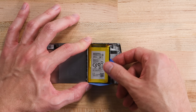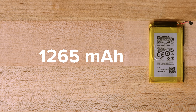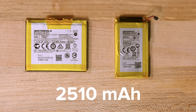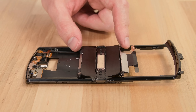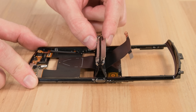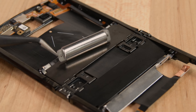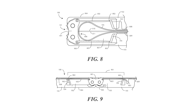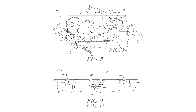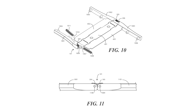That secondary battery is glued and placed in a well on the underside of the display. The idea of prying a battery out against a delicate OLED display is not our idea of fun. This battery is rated at 1,265 mAh, bringing the total battery capacity of the Razr to 2,510 mAh, which is fairly low compared to other flagship phones. With the display out of the way, we can see how the hinge works — it comprises a continuous geared hinge, a cat head cam, two support plates, and a few springs. Motorola's patents illustrate how the cam and support plates work together to protect the fragile OLED display, holding it taut while open, then allowing a generously loose fold to prevent a crease from forming when it shuts.